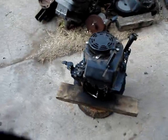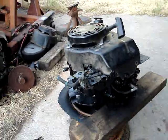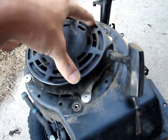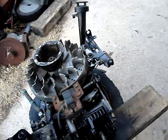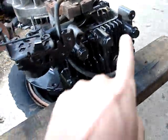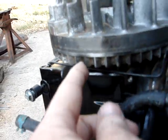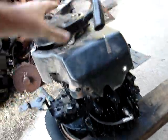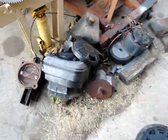The engine I'm going to put on it is a Briggs and Stratton 6.75 horse. Just last night I drilled all the pop rivets out that hold the shroud on and spun it around so the pull start is on this side — it was over on the other side. I already repainted it in places just to give it a fresher look. The cool thing is, even though it didn't have a starter, it already has the flywheel teeth, so if I ever want to put a starter on it, I can. There's the gas tank for it, and I found this other little flywheel shroud.